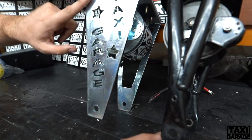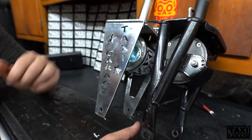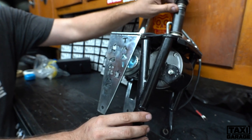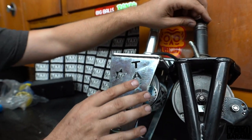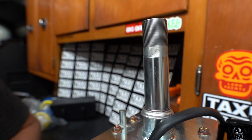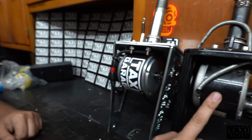The stock neck is tubular; we've gone to a full solid plate that has been TIG welded across the top. The stock one was MIG welded, which is fine for a 90-pound person, but we've had tendencies where this point right here breaks. Going through development and just having fun riding and crashing, we've seen that point fail. The custom neck has a CNC upper plate that gets TIG welded to the upper plate, plus a CNC shank with matching threads for the factory top nut and bearing set.